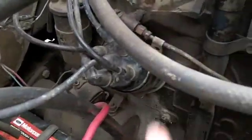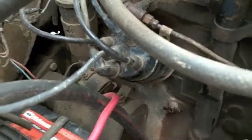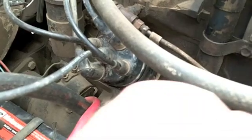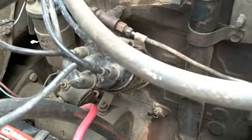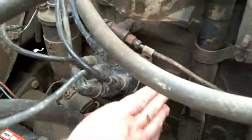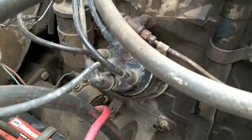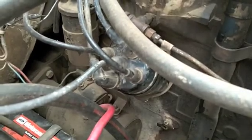Timing-wise, I'd love to tell you precisely what timing I'm running, except I have no idea, because my Jeep — like every other Jeep I've worked on — I can't see the timing marks. I know they're down there, and I know they exist because I saw them when I rebuilt it. I'll have to get some nail polish and paint them. This is still running points and a condenser, with no electronic ignition, which I was told would never work, but it seems to work just fine.